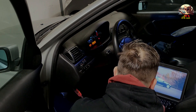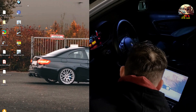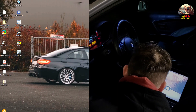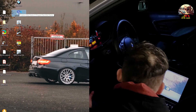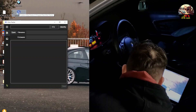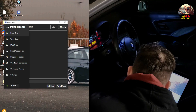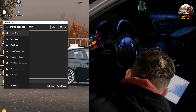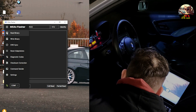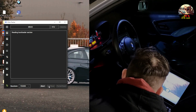Now I will switch to the screen recording. Here is the MS4X Flasher software — I will put the link in the description. I will use it to read and extract the information from the ECU. If you click in the top left corner, you will see the 'Read Binary' option, so we are going to go with that and choose a full read. It takes about four minutes.